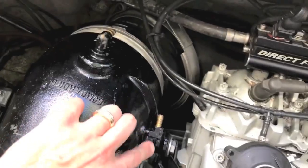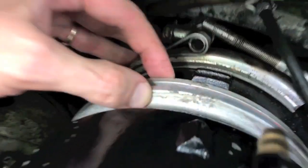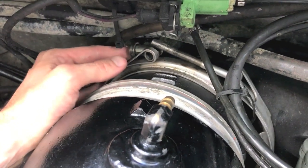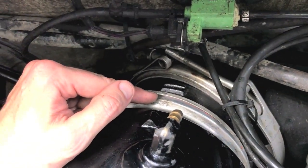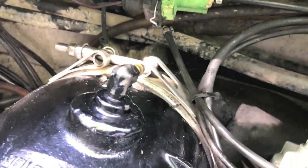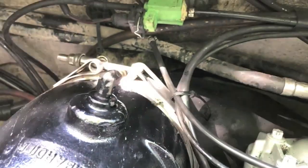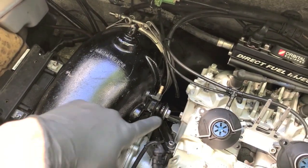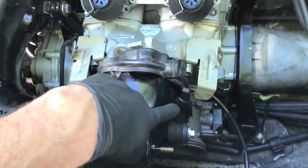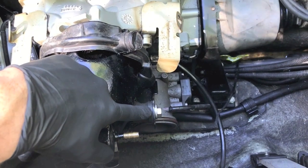The top manifold is in place and touching the actual lower manifold. I've hand-tightened these two bolts and now I'm going to reposition this bracket, making sure they go over the groove, and slowly tighten this. Do not over-tighten it — your goal is to tighten it just until the gasket sealant is bleeding out slightly. Carefully and slowly tighten this ring. The clamp is properly tightened and there is a little bit of sealant bleeding out — do not over-tighten or you push all that sealant out. I have the 18-millimeter bolt fully secured and all four manifold bolts — left upper, right upper, right lower, and the 15-millimeter nut — are secure, along with the half-inch nut on the mount.